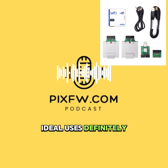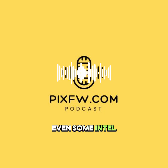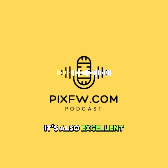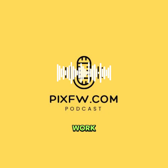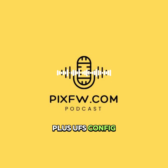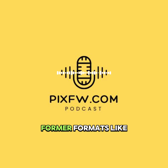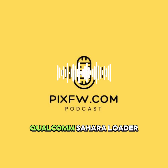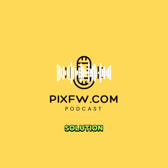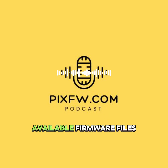Ideal uses: definitely Android IMEI repair — it supports Qualcomm, MediaTek, even some Intel chipsets — that's a huge plus for standard phone repair shops. It's also excellent for deep eMMC work, resizing partitions, reviving dead chips, doing full writes, plus UFS config unlocks and recovering dead Samsung UFS chips. It supports various firmware formats like XML scatter files and Qualcomm Sahara Loader 2. Lots of readily available firmware files online.